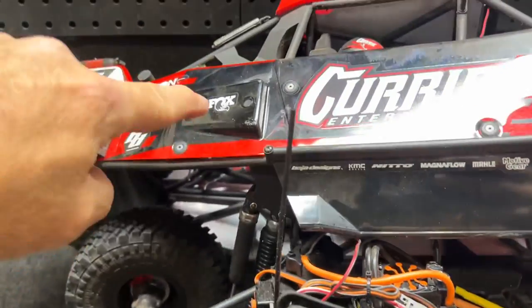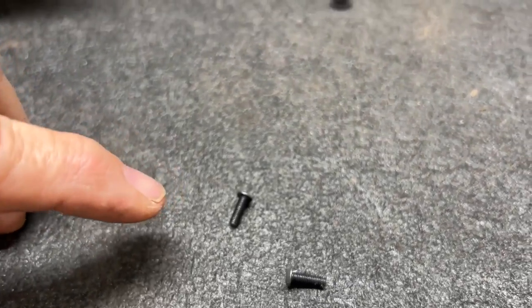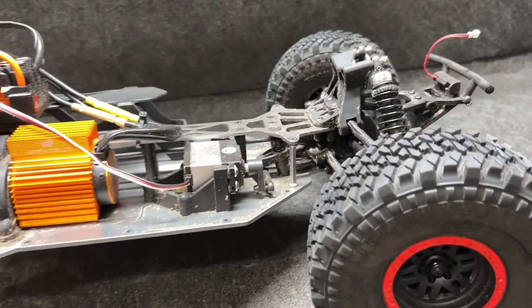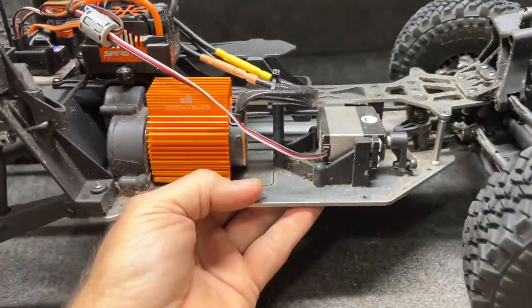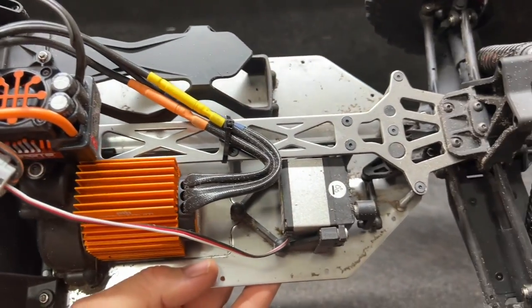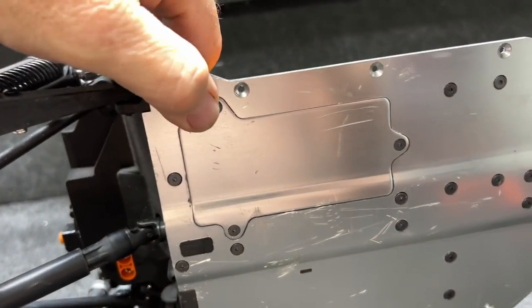It's off. There are a few sneaky ones — got a little rubber grommet right there, those go right underneath. Here's one of the grommets and those are the two little short bolts that have to come out. Unplug the lights back here, unplug the lights there, and the whole body's completely off. Very basic driveline.